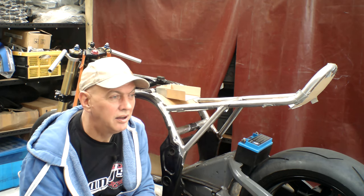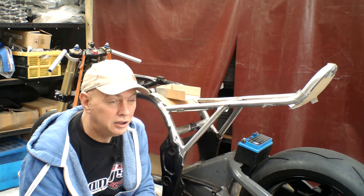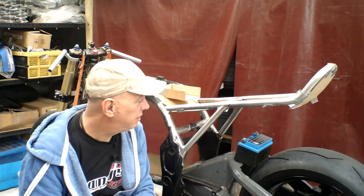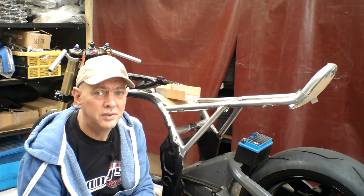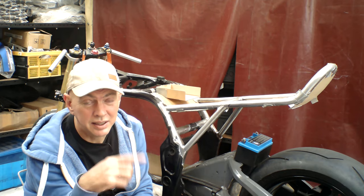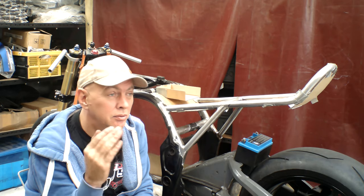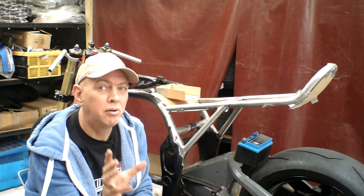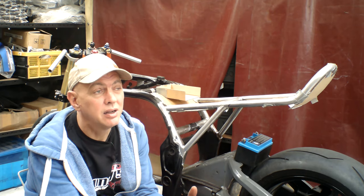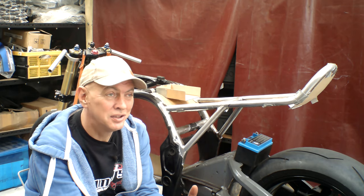But I have been looking at a couple of videos online of people that have got these and played about with them, and these cheap little nasty ones, they're not English wheels. The frame on them is tiny, and there's just too much flex in them. So I'm probably going to build one as well. I'll buy the dies, the anvil and the wheel, because they do need to be absolutely spot on, ground and polished up and everything else. So I'll buy a set of anvils, but I'm thinking about making my own frame for it. And it ain't going to be out of this flimsy box section that you see on some of these other channels.